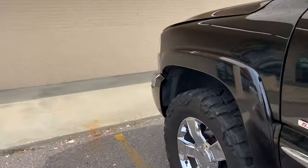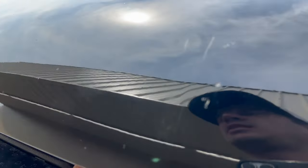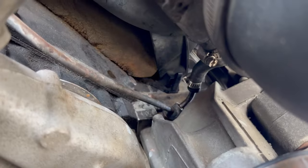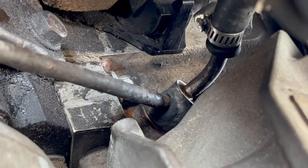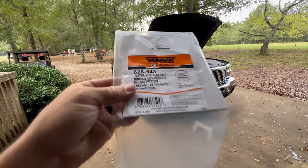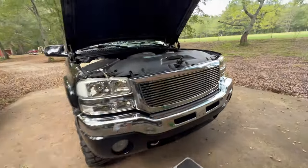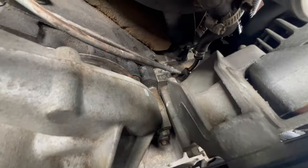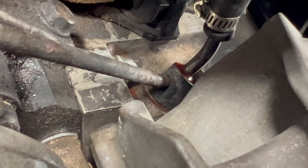She should be warmed up after all that abuse, let's go ahead and check her real quick. Yeah, she's seeping right there at the top it looks like. Thankfully a relatively close-by Advance Auto had one in stock. There's our part number — it's technically called a heater hose assembly in this application, but coolant crossover tube will find you the same information online. It's a good thing we found one. If we take a peek, she is in fact leaking again right there, so good to know that is our issue.